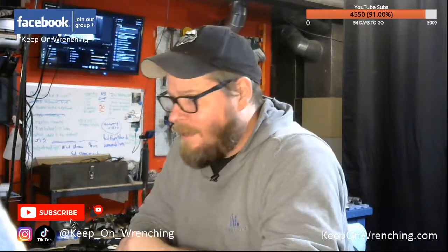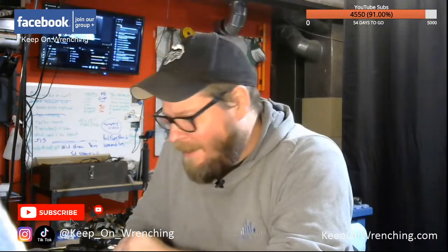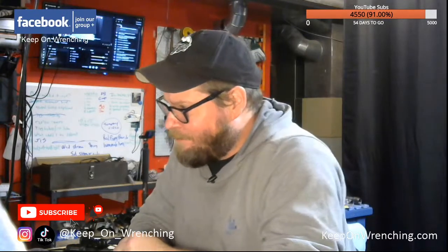I always talk about what are the tools that you really, really need when working on these bikes. If you're trying to do stuff kind of fast, and you don't want to spend all day, and you're not totally OCD like me in a lot of ways, get yourself a little bench grinder and some polishing pads and some compound and you'll be able to crush it.